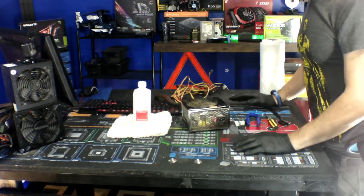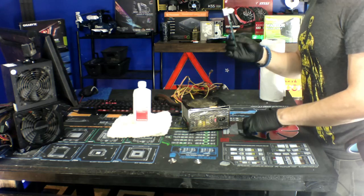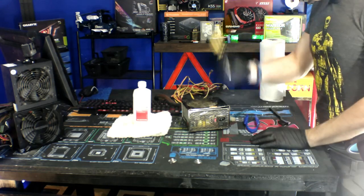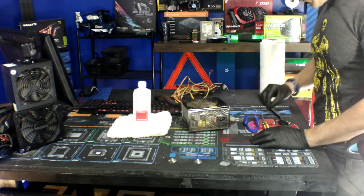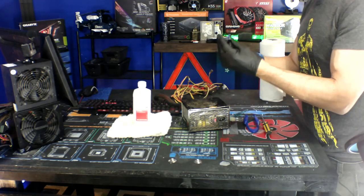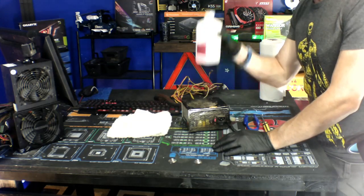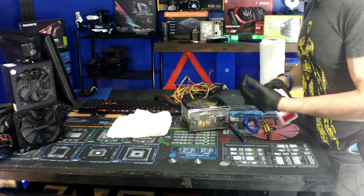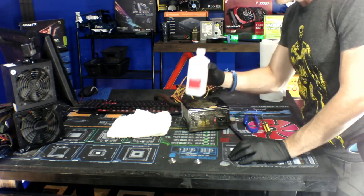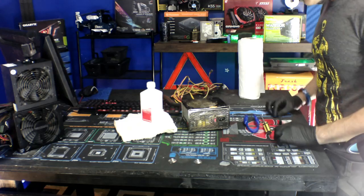There are a few tools you'll need: gloves, a good toothbrush, some type of plastic tool for scraping, a screwdriver to remove the four screws or fan screws, and an electrostatic ESD brush — a specially made plastic-bristle brush that doesn't cause static discharge. You also need alcohol for cleaning — not peroxide, not water, not distilled or mineral water. Alcohol only. And you'll need a towel and some paper towels.